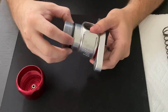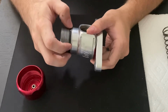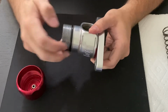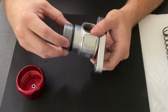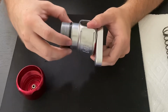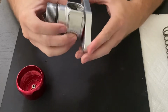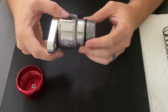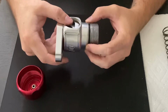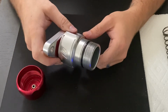But you can basically repurchase these seals, because they do harden, they do tend to crack or weaken or scratch over time, and then they start leaking. When they leak, then your tuner is going to say, hey, we're not getting the accurate air-fuel ratios. Makes my life easier whenever people just do the service. And I recommend doing this like once a year if you can. Even though it may seem a little bit wasteful, it is well worth it, because an air leak from one of these is sometimes hard to find and can cause a lot of mayhem.